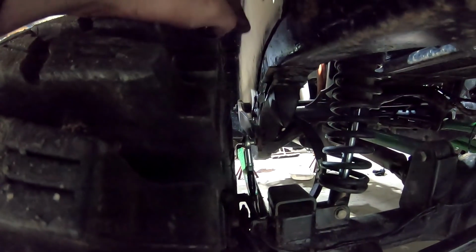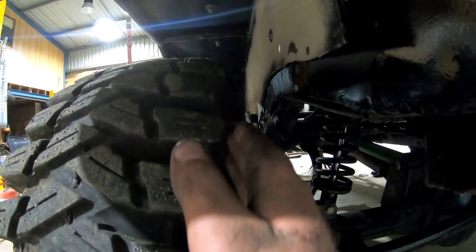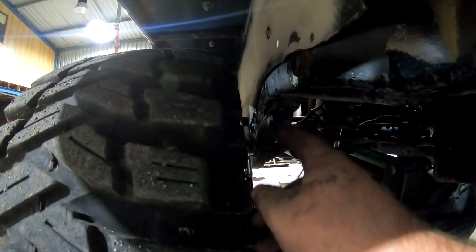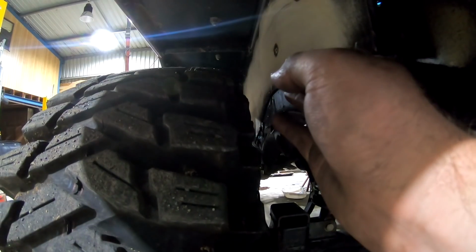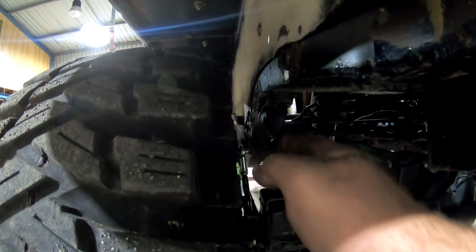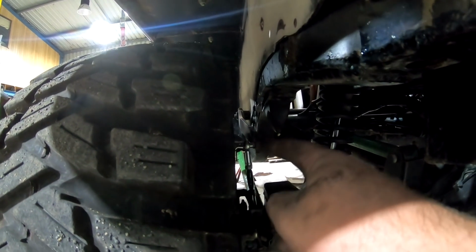And yeah, you can see that there, how much more room between the tyre and the arm as well, compared to when it was up here. It was right next to the tread blocks on the inside there, so it all looks good. Now when it's up the top near the tread blocks, if you can imagine, as the wheel goes up into the guard to flex, it goes up and in, and it hits the guard anyway. It hits the inner guard on wagons and everything. So if that sway bar link is near the top of the tyre there, as the tyre goes up and in on its radius, it inevitably hits the sway bar like super easy. So that's why, yeah, closer to the middle of the rim. So as this wheel goes up and in, less chance of it making contact there.